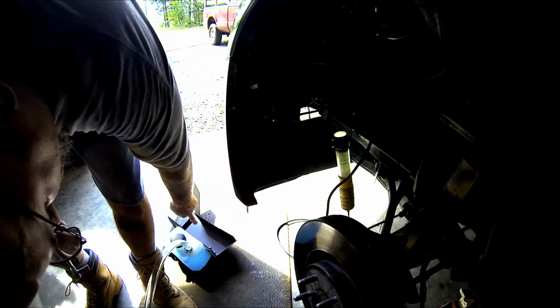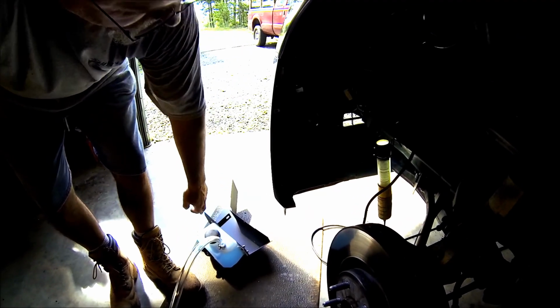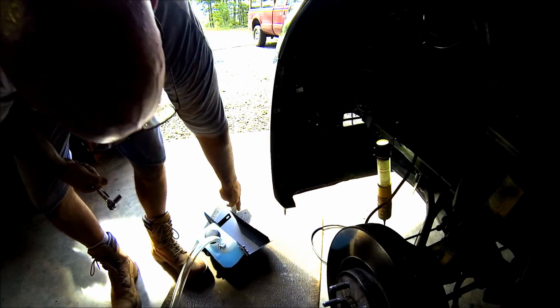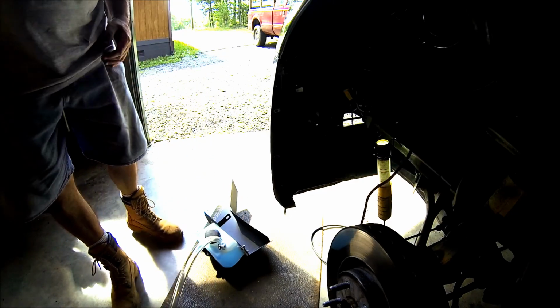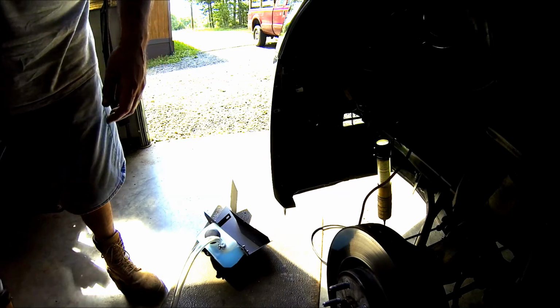The horn's mounted right here. This has to come out, and we're going to put this longer bolt in so that we can screw it in through here to that hanger. And then we'll bolt in to the side of the frame right here. We'll use one of the pre-existing bolts that was in the old washer system. Wonderful. Working on the floor is so much fun.